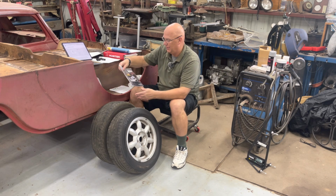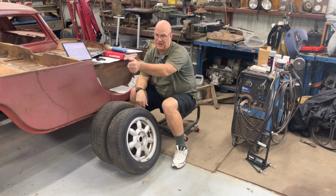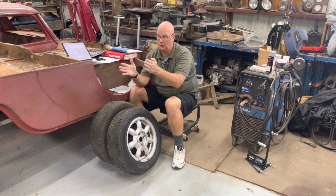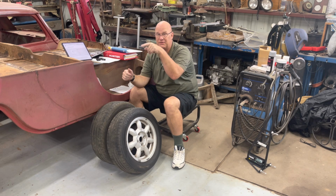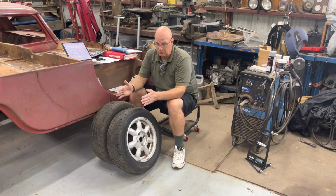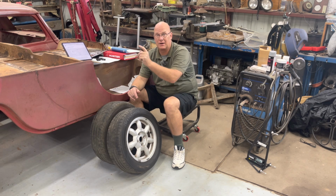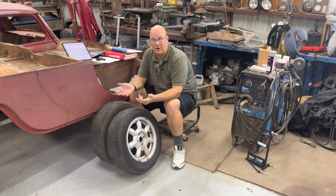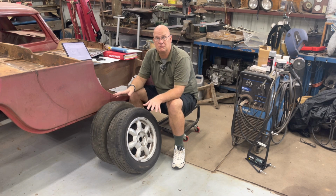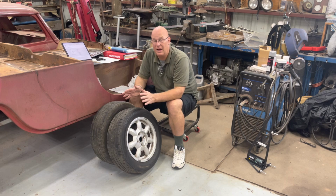Smart Racing Products, another good picture in their string manual, say to put a piece of tape on your dash, sit in the driver's seat, get the wheels exactly straight forward, get the steering wheel exactly level, and put a piece of tape on the wheel. Then use whatever you've got, markings on the ground, to figure out 20 degrees left, and put a piece of tape so the steering wheel lines up with the mark on the dash. Do the same thing to the right. Then when you're doing this yourself, you don't have to worry about the 20-degree thing, you just have to worry about how the tires are going to slide without catching. Just move the wheel to the tape marks. I like that idea. I have not done that, but I like that idea.